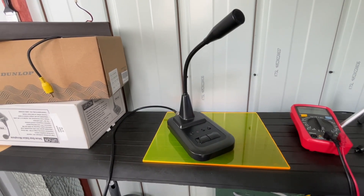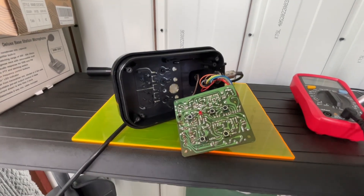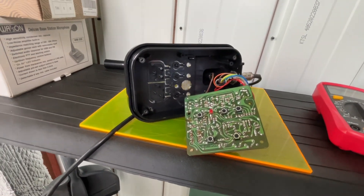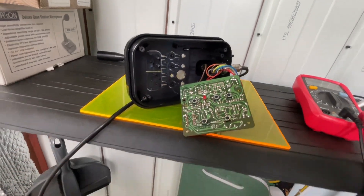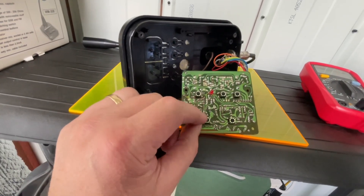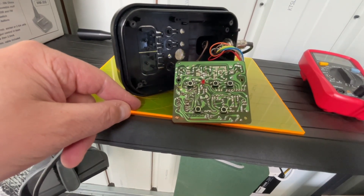I've managed to get the back off and take the screws out. If we bend these over we can see it's a very simple sort of assembly. There doesn't seem to be anything wrong with the circuit board itself — it certainly had no batteries melting or anything like that. These plastic buttons simply push the circuit board buttons, and I immediately notice the power button and the up and down buttons work perfectly, but these buttons — you can't tell on the video — are just broken from overuse.